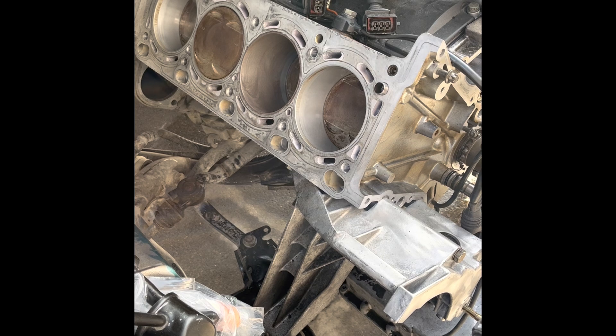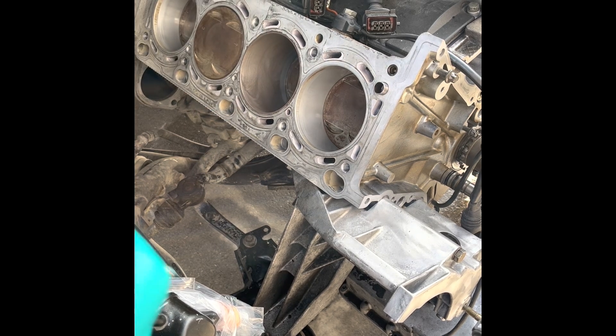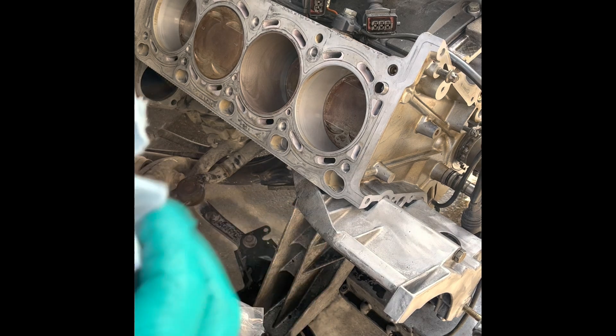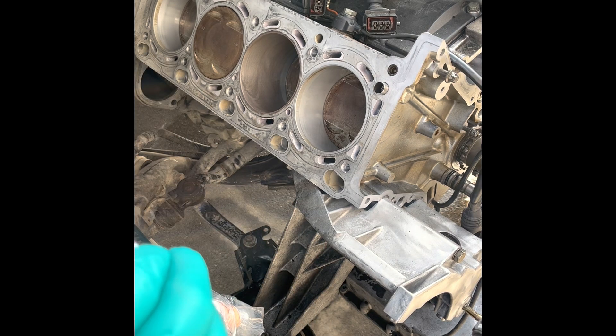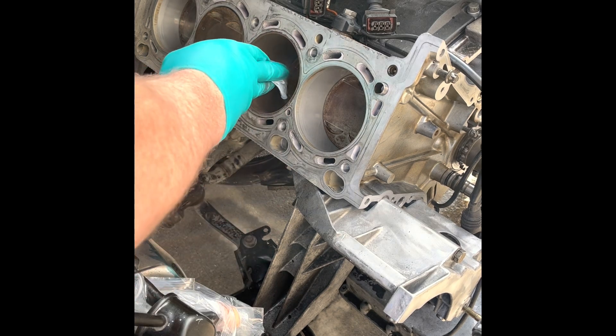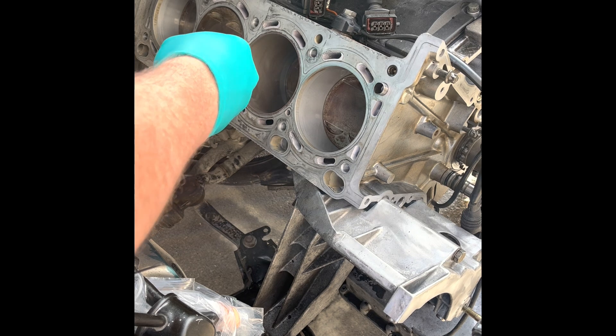I've buffed the full area inside the cylinder here, leaving just about a centimeter or so at the bottom above the piston. From this point it's just a matter of getting the abrasive compound out without working it down. I'm going to take little bits of shop rag starting from the bottom and wiping it down.